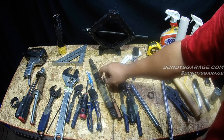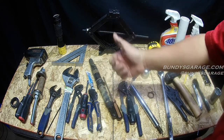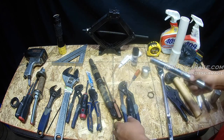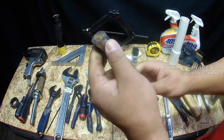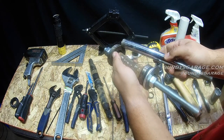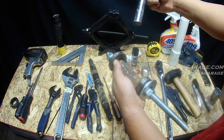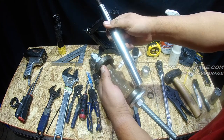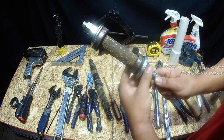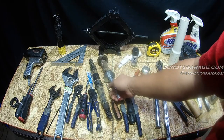That's the only way you want to knock it loose because you have this ring right here that's pressed onto the shaft. You're not going to be able to get that out, so you want to press the shaft from the bottom up from the bottom end of the tub. Then once I had access there, I tapped out onto the edge of the bearing. So the bearing would be sitting in here like this on the shaft, and I hit the edge of the bearing from the bottom to the top, hit this bearing out and went in from the inside of the tub, knocked the bottom bearing out. And that's when all this stuff — the sleeve, the crush washer, and the bearing — all came out at the same time.